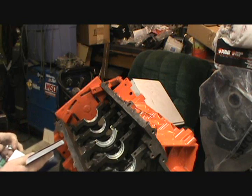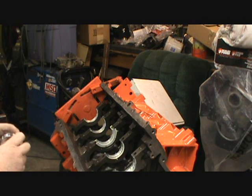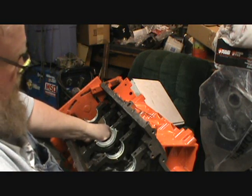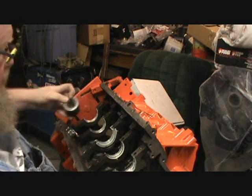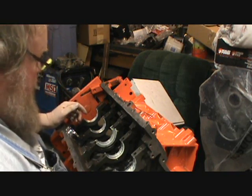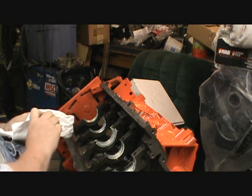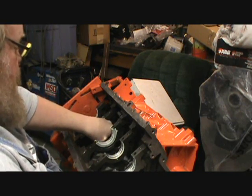So number 4 should be a 10-2. I ain't worried about where that other cam-bearing hole lines up, since there's two of them in this. I guess using motor oil on the rubber might have made her too slick. Finding the white lithium grease now from the crank. Okay. Like I said, I'm just going to pick one of the two holes.